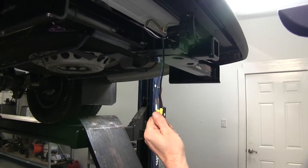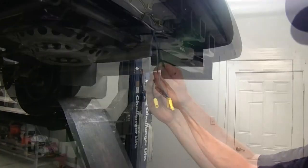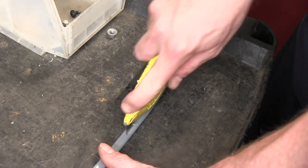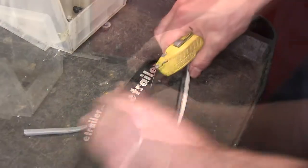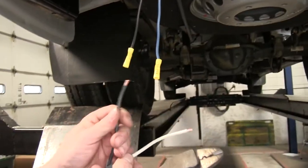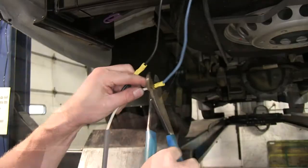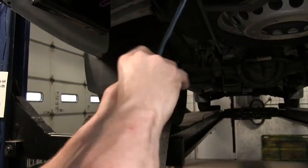Now we'll work with our last two wires: our blue and our black. The black wire is typically used for a 12-volt power supply, and the blue wire will be our output from our brake controller. We'll hook up the gray cable that comes with the ETBC7 kit to these two wires. We'll get the cable ready, remove the gray sheath, strip the wire back, and use the pre-installed block connectors — black to black and white to blue. We'll add some electric tape to protect the connections.